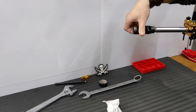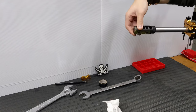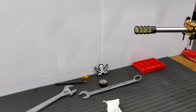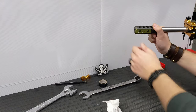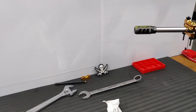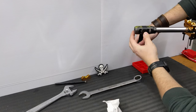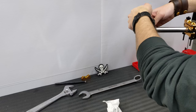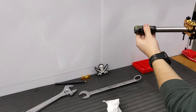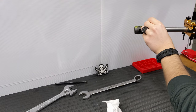We're going to spin this brake on. Before I started rolling here, I did level out this rifle in my vice — quite like the Arca Rail for that. I've attached just off on the edge of the camera my Wheeler Engineering level so I can see it, as well as using the level back on the scope. You basically want to spin it around until it becomes finger tight. Then what you're going to do is hold the timing nut and back this out to where it's level. Just so I don't mar the finish on the actual brake when I put the spanner on it, I'm going to run a little bit of electrical tape around there.